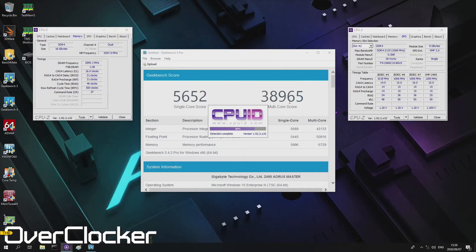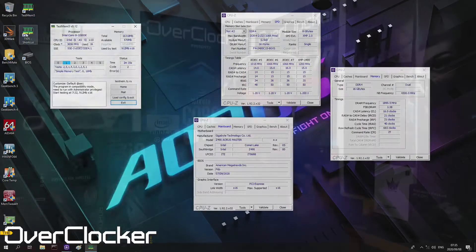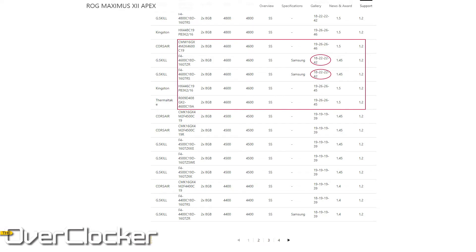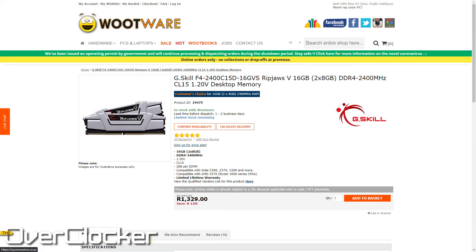It really speaks to the fact that these ICs overclock well. G.Skill is the go-to DRAM for overclocking — they charge less than any other vendor for equivalent or perhaps slightly better quality DRAM. You can see it even in the timings: compare any G.Skill 3600 Ripjaws 5 SKU to other vendors and G.Skill's timings are actually lower. When it comes to overclocking records, who has a more prolific history than G.Skill? Overall, I'm not going to waffle on — this is a cheap kit available at Wootware, costing as much as other 3000 or 3200 kits, but I would actually choose this kit over any of them.